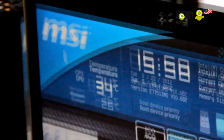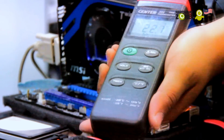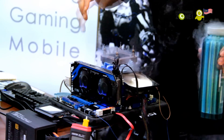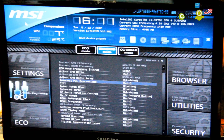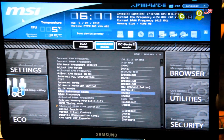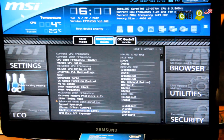Now it's time to start up the computer. Always keep an eye on the temperature displayed in the BIOS and thermometer. The BIOS displays the temperature of the processor, while the thermometer tracks the temperature of the pot. Now pour in the liquid nitrogen. This will allow the temperature to reach well below freezing level. Try to get the CPU's temperature down to at least negative 100 degrees Celsius. Then enter the BIOS and turn off all power saving features on the board, as well as disable any performance enhancing settings such as turbo boost and hyper-threading.